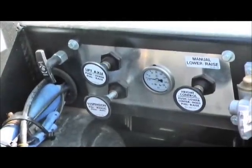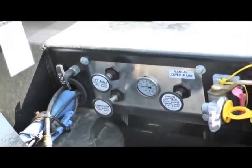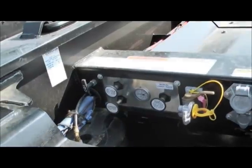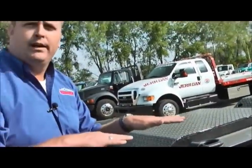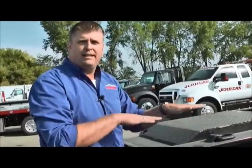Now the trailer is getting down on solid frame. When you go to detach, you have a common point. If you have a load on here and you go to pull off, the bags will want to swell and then you have an uncommon point. So what we're going to do is dump everything, get it solid, and that'll allow us a good detach — and when we go to reattach, we have a common point.